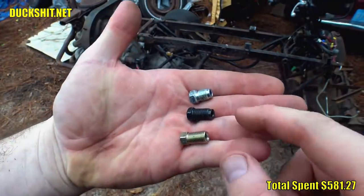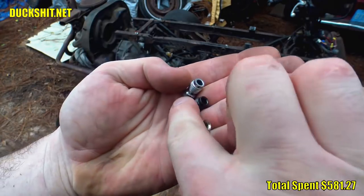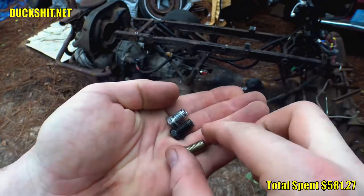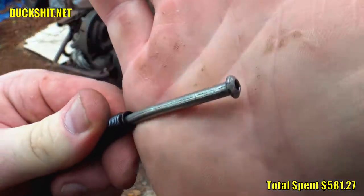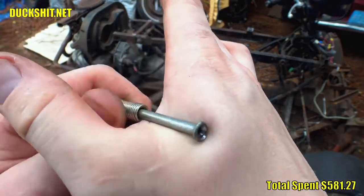So here's a comparison of the different joints that I'm forced to use with this potpourri of hydraulic engineering mess. I wish they were all the same, but I'm just not so lucky. Some are metric, some are imperial, some of the devices require bubble flares, while some are double inverted flare and other combinations between all the above.